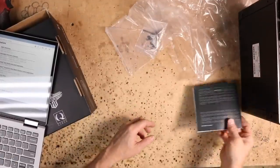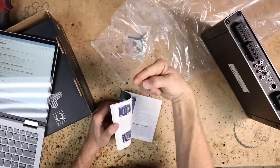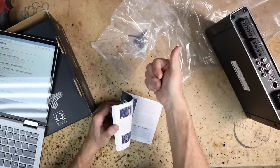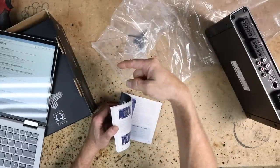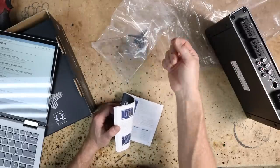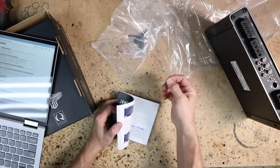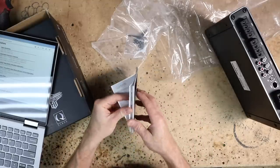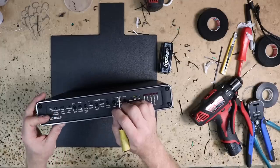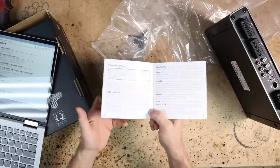We also need to test how we're going to turn this amplifier on. Is there an accessory wire we can tap into behind the radio in this vehicle? There's not. Most amplifiers come with DC offset — a small amount of DC voltage that comes over the speaker line, and when the amplifier sees that, it turns on. Some amplifiers also have signal sense, which looks for movement on the line, meaning you're playing sound, and then turns on the amplifier. This amplifier has all three: remote turn on, DC offset, as well as signal sense input over audio. So we need to test for that.